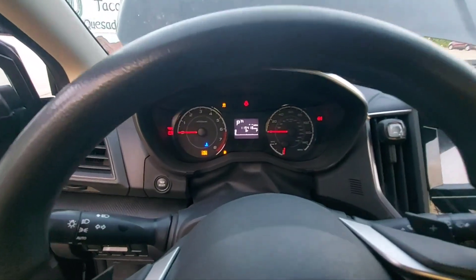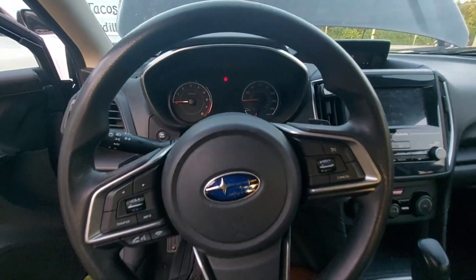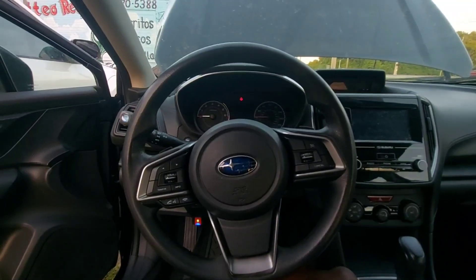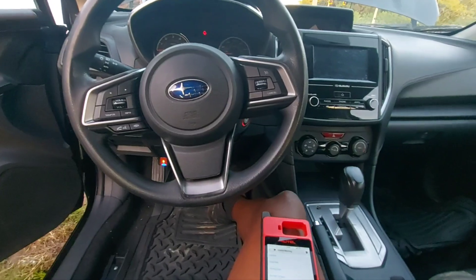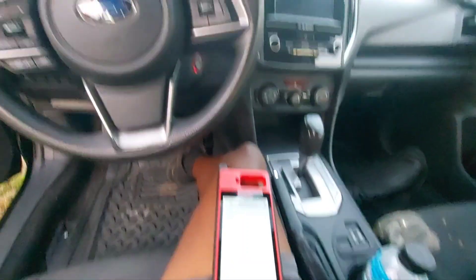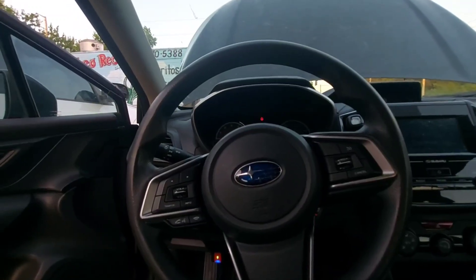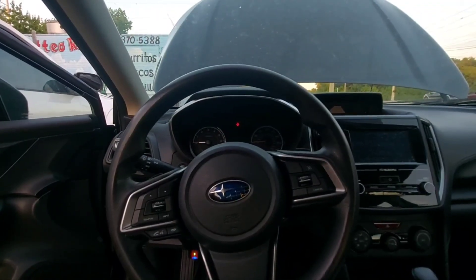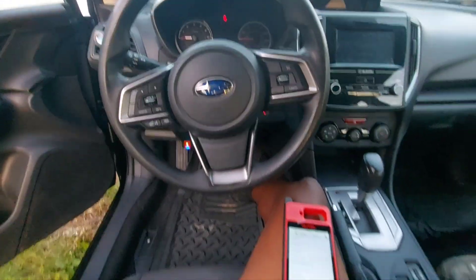It does crank over, but this particular vehicle doesn't run. So that's another one — 2017 Subaru Impreza, H key. The programming procedure for all-keys-lost is going to require you to back up the EEPROM data via OBD, create an analog key, and then add your key using the 'Add a Key' feature. If there are already three keys in the system — apparently three is the max — you'll need to erase all the keys and go back in and do 'Add a Key' again. Thanks for watching — LakelandCarKeys.com.